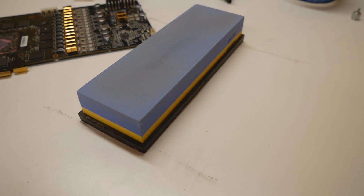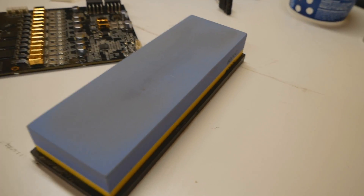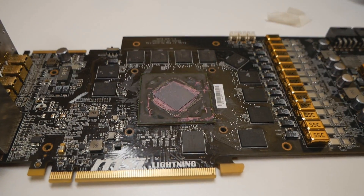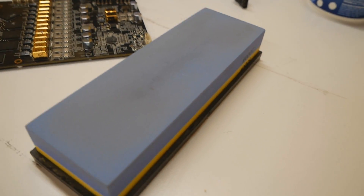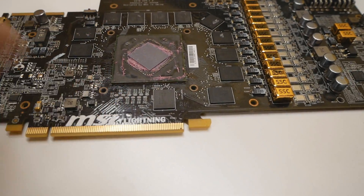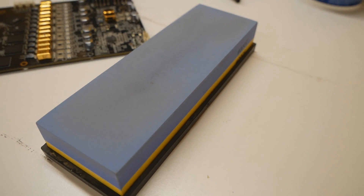There's a lot more risk with the previous glass plate method because the plate can easily wobble when you move it on top of the GPU. DeBauer mentioned this in his video — if you can get a very long glass panel like he used, that could be the best option. But based on this thermal paste spread, you can't really go any better. The images DanKarp showed me after unmounting his GPU container didn't look any better than what I have here — this is definitely the best result I've ever had with a GPU cooling mounting.